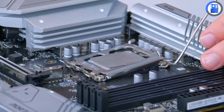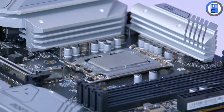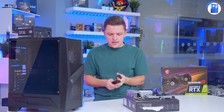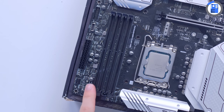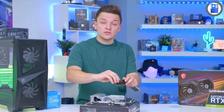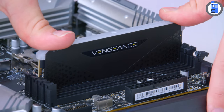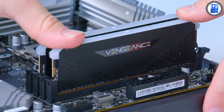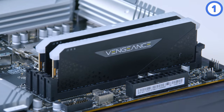The black plastic protective cover will then pop off, the arm goes down, and that will fasten everything into place. For the RAM, we've got four DIMM slots but only two RAM DIMMs, so we're going to use the second and fourth slots — you always want to use alternate slots if you've only got two DIMMs. Beware: this is a DDR4 motherboard, not DDR5. Those more expensive DDR5 boards won't physically work with DDR4 memory.